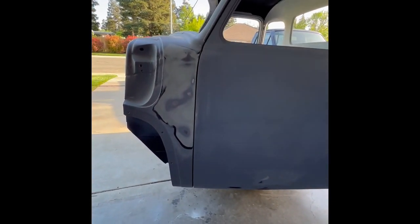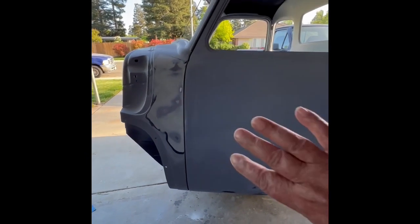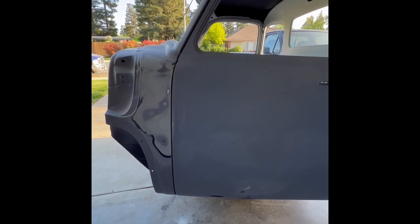I've put the door back on and my gap seems pretty good here. I'm gonna just look and see how my in and out is. It's pretty good! So my door's adjusted in and out. I know everybody shows you how to tilt your door - that's the obvious part - but it's the in and out that was killing me. Good luck, let me know how it worked out for you. And don't forget to re-weld that hinge when you're done!